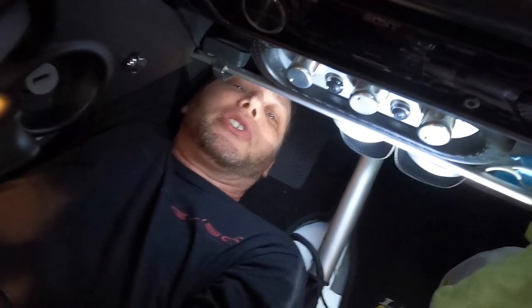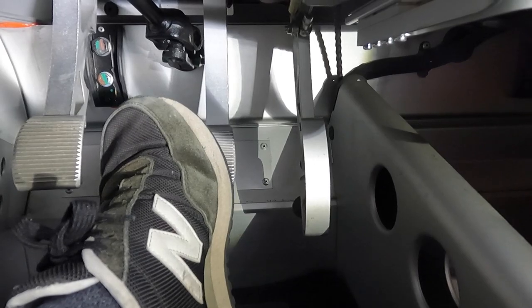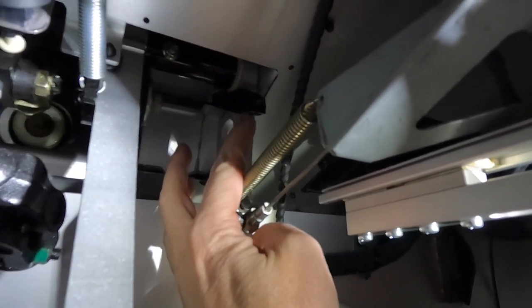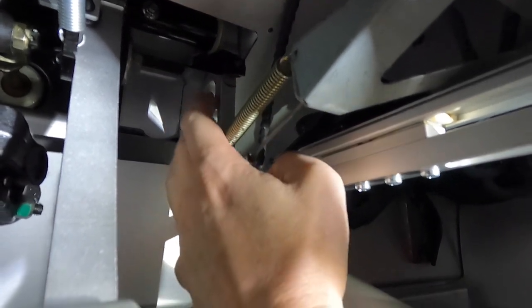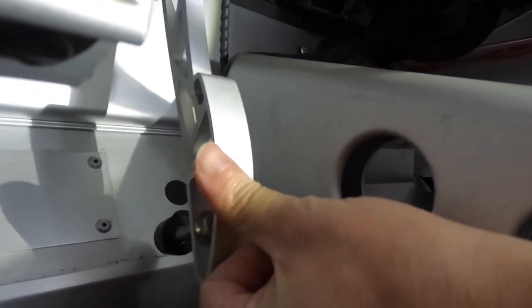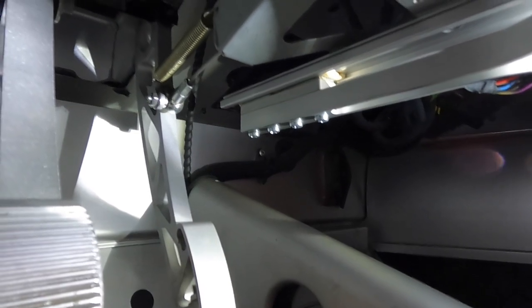This is a lovely and comfortable position. It's hard to tell, but it is a little bit past the gas pedal. So what we want to do rather than try to raise the brake pedal up even more, we want to lower that gas pedal a little bit. First, what we have to do is see where the pedal comes right here - this is called the upstop. What we want to do is replace this little rubber thing with a bolt that spaces this out a tiny bit more than what it normally would be. And then we need to replace this downstop - the stopper that actually stops the gas pedal from going too far - with a slightly smaller bolt so that it can go further. So we're basically just shifting the entire thing down a little bit.